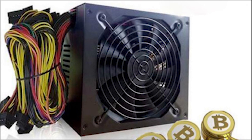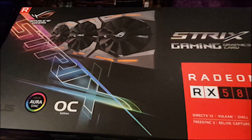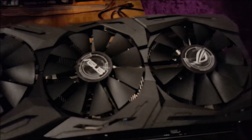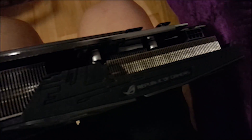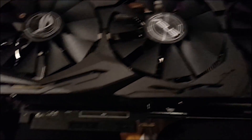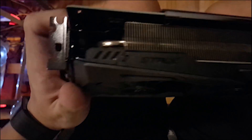Up next, the graphic cards: ASUS Strix RX 580, GDDR5, 8GB video memory, 3 fans with decent heatsinks, and a solid backplate. The connector for this is just one 8-pin PCIe connection. Word of caution to those planning on using this: it's best to remove the plastic sticker or cover of the backplate. I heard a story from another miner here in the Philippines where he didn't remove the plastic and after a couple of hours mining, one peeled off, got stuck in the fan of the GPU behind it, and broke a fan blade. So don't say I didn't warn you.